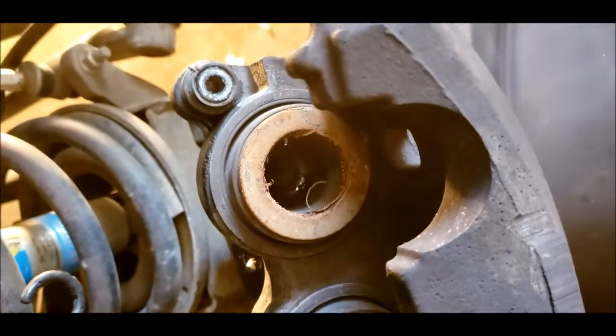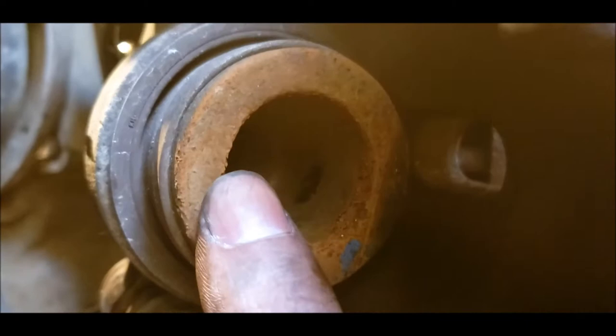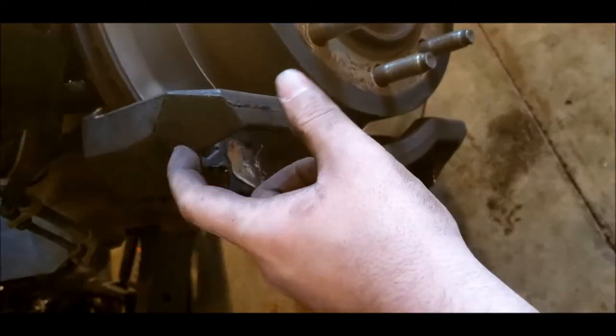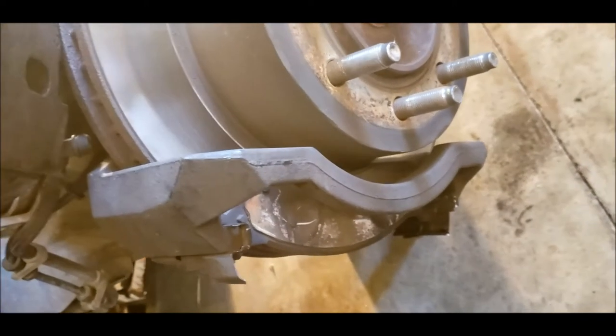I think this was the issue. I've got these little nipples sticking out on the brake pad, and the caliper had pushed all the way up against it but couldn't come up over that lip. So I had to compress it just a tiny bit more with that C-clamp to get it to fit over this lip. Really horrible design. And this is what the calipers look like removed - I think I was rubbing up against right in here, and you can tell from the scratches that's what was going on. So my recommendation: take this off, but you're going to need a half-inch pry bar or a better 3/8-inch pry bar.